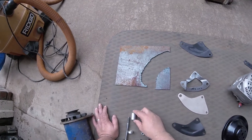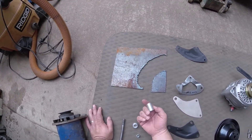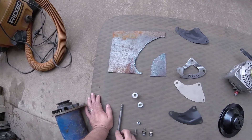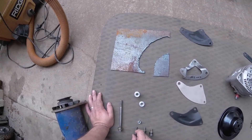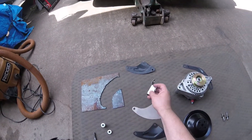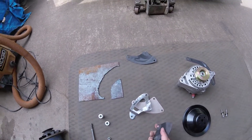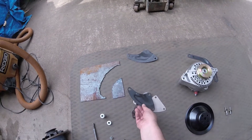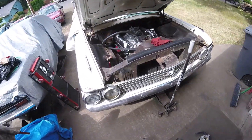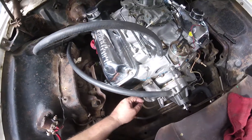Here are some of the parts used. Here are the aluminum spacers that were cut out on a blade by my race-car fab guy. The back spacer is an inch and a quarter and the front is three-eighths of an inch. These are the original Ford bolts being used — maintaining the integrity of all Ford components. This is the outside view; the engine side goes toward the block and this component bolts on the outside. This is going into a '62 Ford with the 390.